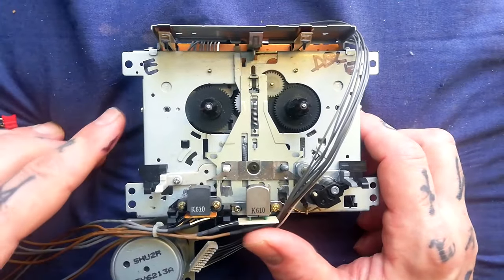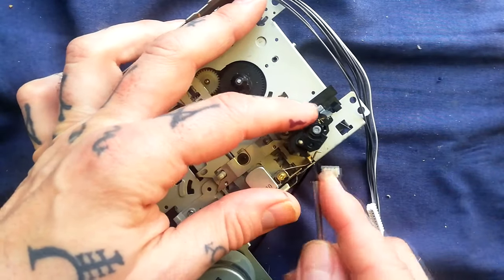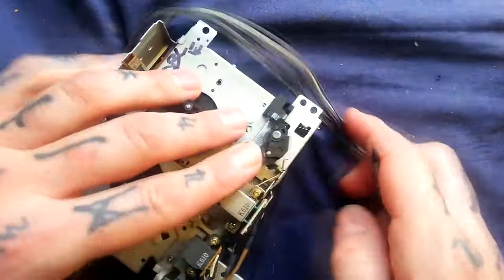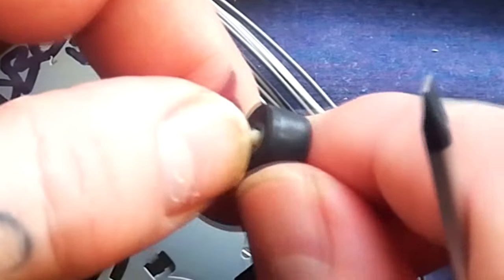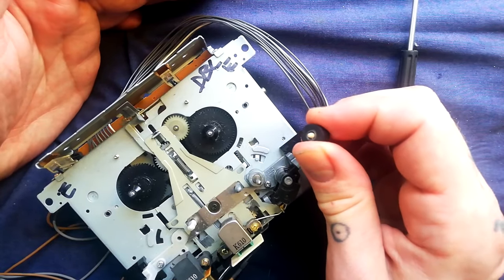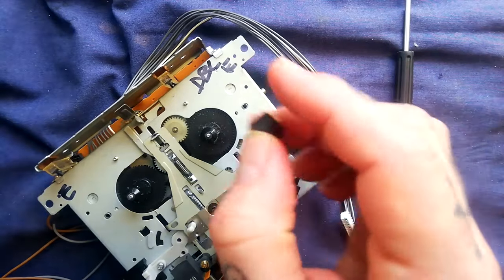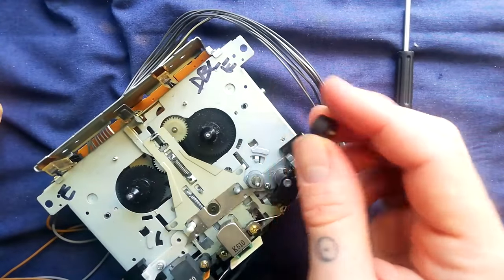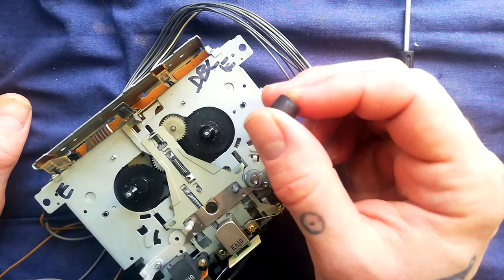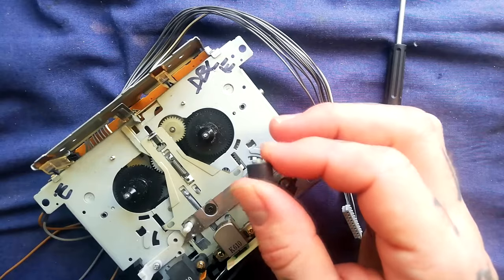One of the common things you'd want to do when refurbishing one of these is change the rubber belts and clean or replace the pinch roller. The pinch roller is pretty simple on this: just get a small flat-head screwdriver, jam it into the space between the bottom of the pinch roller and the plastic pinch roller arm, and it'll just pop out. There's a little bit of shine on the surface but it's basically okay. I haven't really found any bad pinch rollers from this 90s generation yet, so they seem to still be within their shelf life. I'll probably put that into a tin of MG Chemicals Rubber Renew, wiggle it about, and then rub the dirt off onto a paper towel and reinstall it, though you can get replacements on AliExpress and similar places.